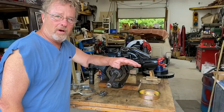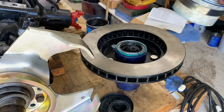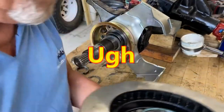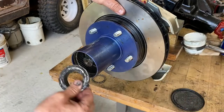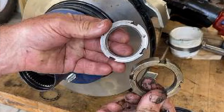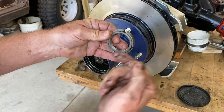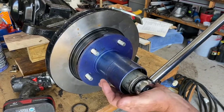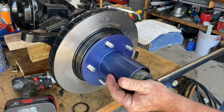All the work's been done and I'm ready for final assembly. I'm installing my repacked bearing — I've got my bearing and my seal on the hub. Now we take the inner bearing and slide that over the spindle. There are two rings that look almost the same except one has a pin sticking out of it; that one goes on first with the pin out. Torque the wheel bearing adjusting nut to 50 foot-pounds, then back it off 90 degrees.